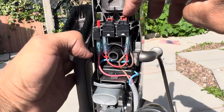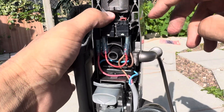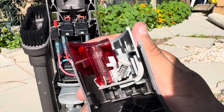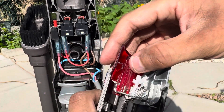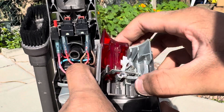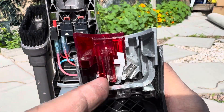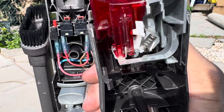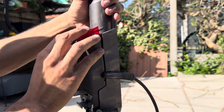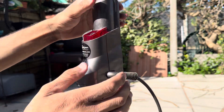What I like to do is make sure that the switches are down so it makes putting the cover on a lot easier. Make sure your brush bar switch has these parts fitted. I recommend cleaning this out as well — just giving it a wipe down because the switches can get a bit sticky over time. If yours doesn't have this metal piece, don't worry, this is the first time I've seen one of these. Push the switch cover back on just like that.